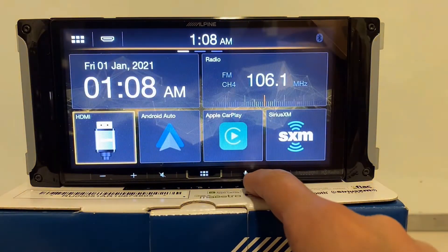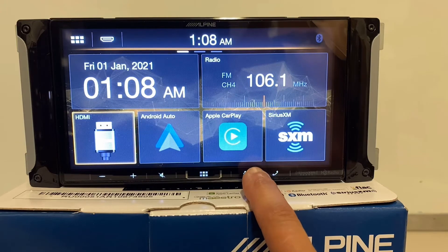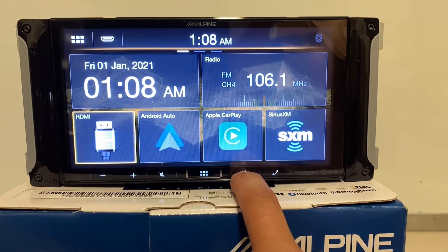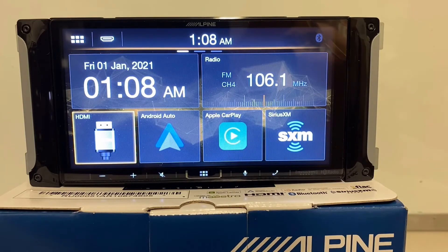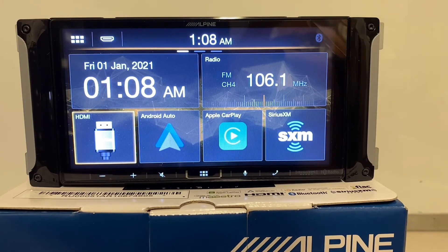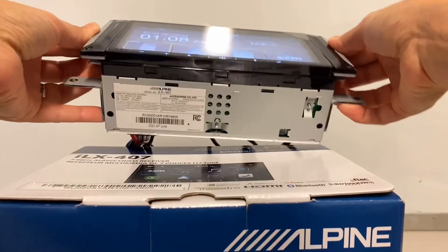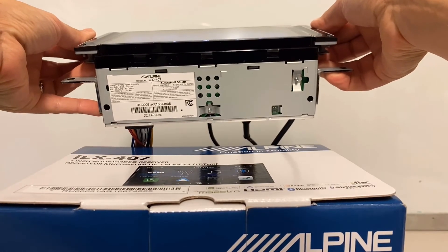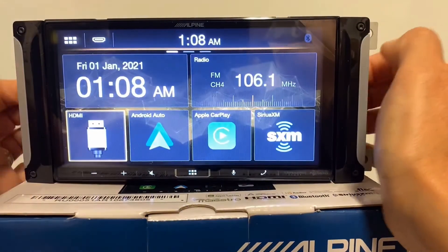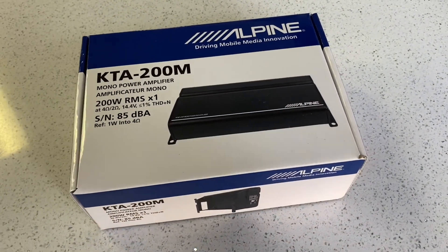You always have this little shortcut to activate Siri, which is nice if you have a vehicle that doesn't have steering wheel controls. You could also turn on Hey Siri or Google Voice to activate that. It is completely touch screen — these buttons down here are not actual hard buttons; this is a completely glass screen, very sleek, with no actual hard buttons anywhere on it. Look how shallow that baby is — that's why you can do that power pack amplifier and bolt it right onto the back. That makes it like a full double-DIN radio. You could either do the KTA-450, which gives you 50 watts by 4 RMS, or they also have a mono amp, the KTA-200M, which gives you 200-watt mono for your subwoofer.